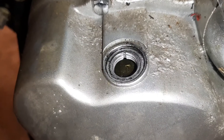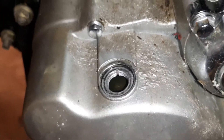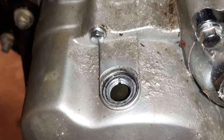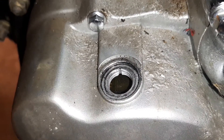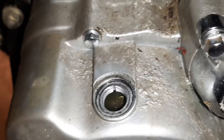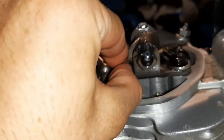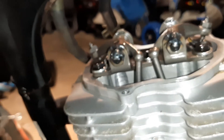I passed it, so I'm going to take another spin around — this time it should be on the compression side. Coming up nice and slow — you want to line up that line perfectly with that notch. Now we're at top dead center. One thing you can do to check is make sure you have a little play in those rocker arms. You can even hear that click — that means we're at top dead center and there's no stress on those valves.